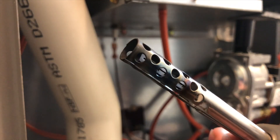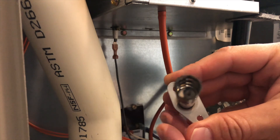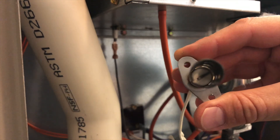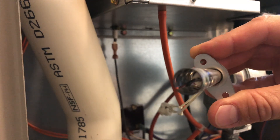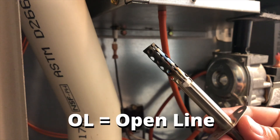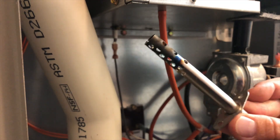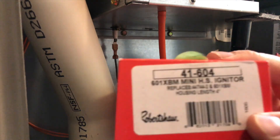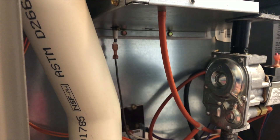If you look closely at this igniter you can see that there's a metal shield, and down inside there's a little probe that conducts electricity. If that electricity can't flow through there it won't get hot to light the burners. We need this to conduct electricity. If it has a high resistance or if your meter says OL — no continuity at all — it can cause this to not get hot enough or not glow at all and not light your burners. I'm going to go ahead and put in this 41-604 Robert Shaw replacement part, and once I get this put back in we'll give it another test and see how she runs.